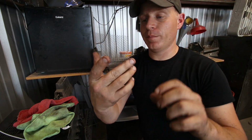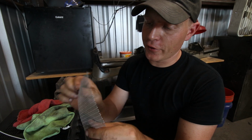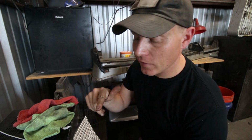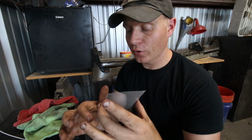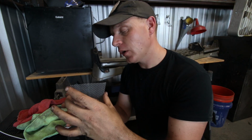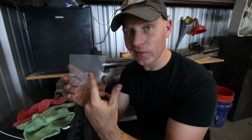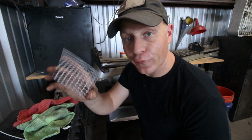So what I ended up picking up was just a little square for drywall patching. It's very, very malleable, can be bent. What I'm gonna do is I'll trace out an area that I need and cut these to be able to place there to give it some structural integrity. I'll do a couple little JB welds with this to get it to hold into place, mold it to how I need it to, and then I'll go back through and continue adding to this to build up and re-strengthen that JB weld to fill in those areas.